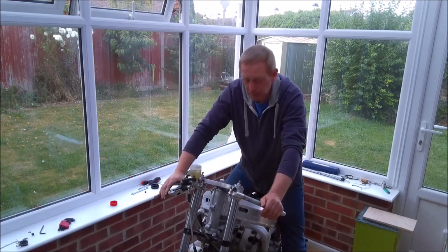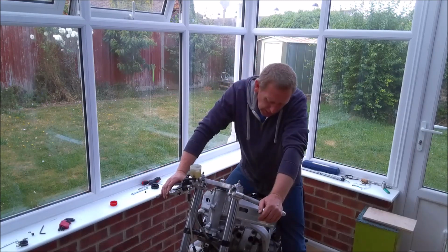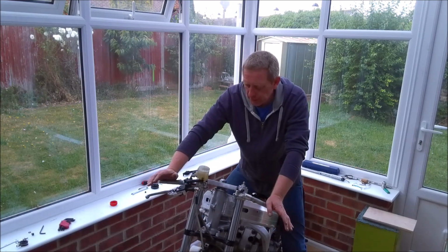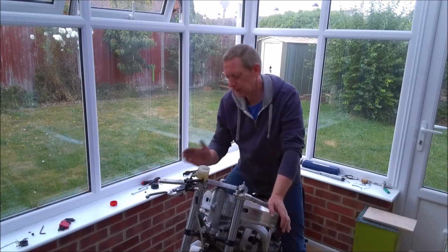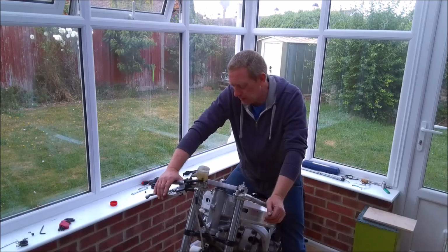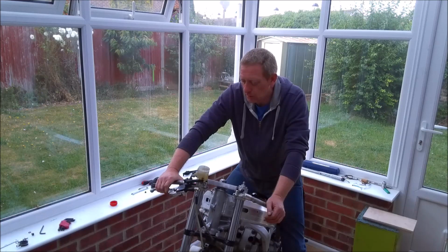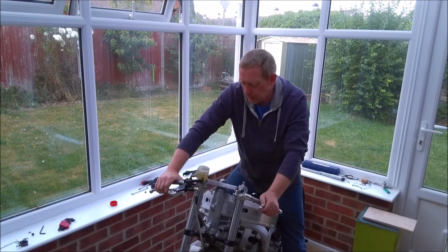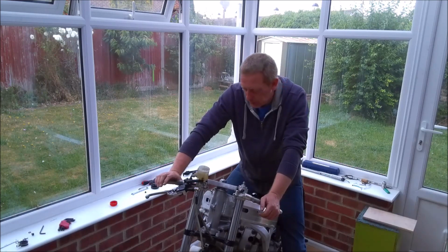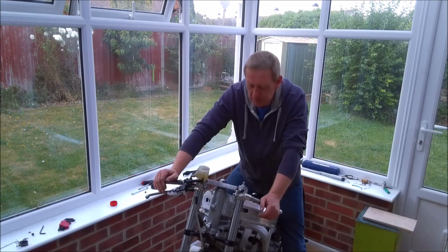and obviously aside from the cable running on it, that's all working well. So we've covered a few little old school tricks. As I said, when you're bleeding them, try and turn the handlebars across in the opposite direction to the caliper you're bleeding. Raise the nipple to the highest point, and then 5 or 6 good strong pumps. Release the nipple, bleed it through, close the nipple, release the lever. Usually works.